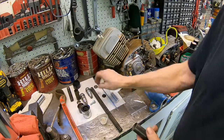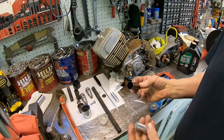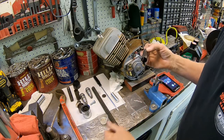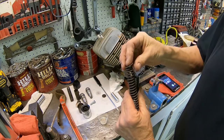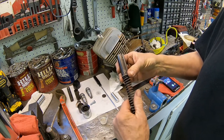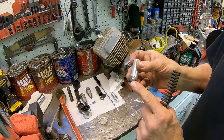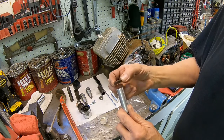Okay, here was the issue. The springs go in there fine. The adapter that goes between the two springs goes in fine. It's this piece that is bigger than the springs. See, you're supposed to have this go on there, and then this. Those won't go in there. They're just large enough that they won't. So I went over to the lathe, made two out of aluminum with this adapter on the bottom to keep this centered. And then shouldn't have any problem with the wafer on top.